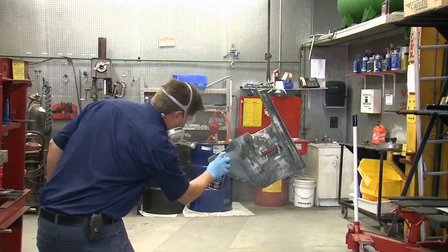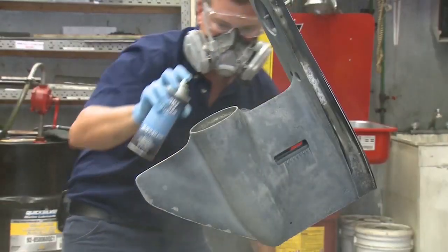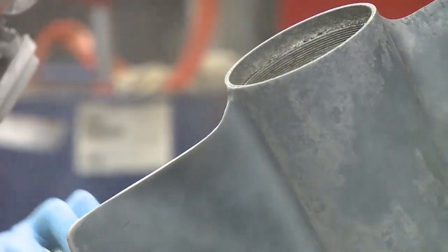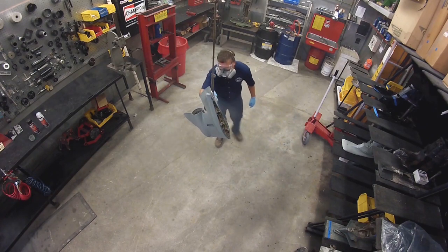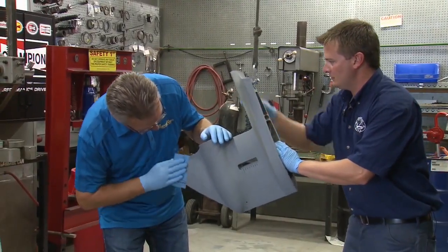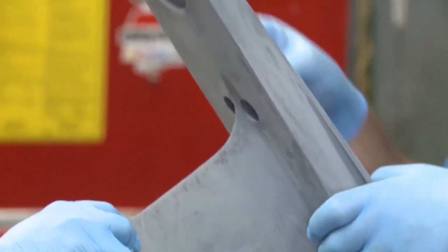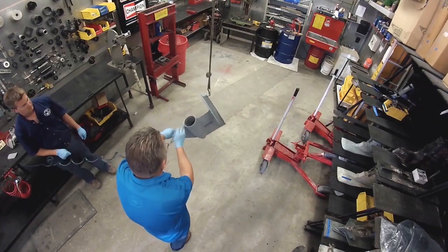The best setup to paint the case, if it is off your motor, is to hang it. When applying the primer or any paints, first apply a light or flash coat with steady sweeping motions to the entire drive case. Next, follow that up with a wet coat to completely cover the aluminum with an even layer of primer. After just 1 hour of drying time, lightly sand the primer to create the required mechanical grip for the color coats. Ensure that you blow off all of the dust.